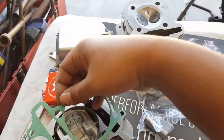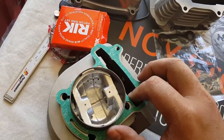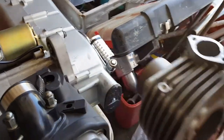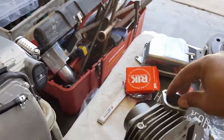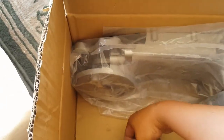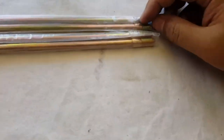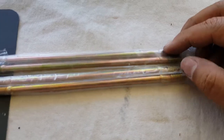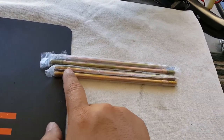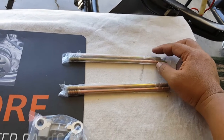The piston is going to sit right here — see how it fits in perfectly. You also got your dowel pins, which go right into the back of the crankcase — they fit right in like this. And this is going to be for your chain tensioner guide as well. Next, we're going to look at the studs. There's a longer stud and a shorter stud, off by about a centimeter. Keep in mind the thicker notch faces outward for the rocker arms to rest on, and the shorter one goes inside the crankcase. The short one goes to the left side of the crankcase, and the longer one goes to the long side of the crankcase.